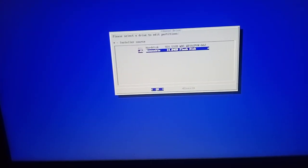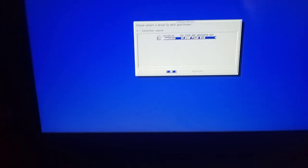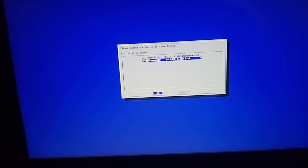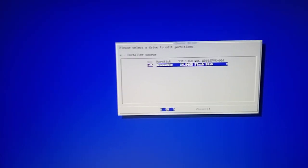But as it is, as I say, get yourself another USB stick, have that plugged into the side, and then when it comes to the installer, install it to that USB stick. Okay, and then, because of course we've already told the PC to load up with USB first if it's plugged in, anytime you want to play Android TV, just plug the USB device into your laptop, and then turn your laptop on, and it will just auto boot from that USB. And then you've still got all of the stuff within the computer being used. Alright. So that's the only way around that at the moment.